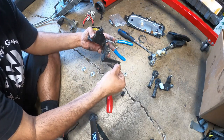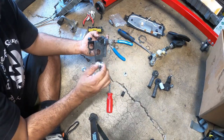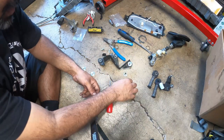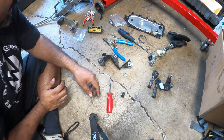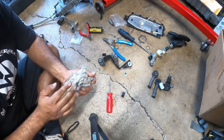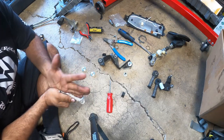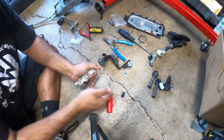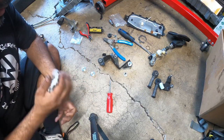Gives you pretty much a solid bracket versus a rubberized bracket, so no vibration. A more direct, more sporty feel to your transmission. This is a super cheap upgrade. They're typically about $30, $40 at your door with taxes and shipping. So an easy upgrade for anybody's Mark 4, Mark 5 shift linkage. Again, this just gets rid of the slop of a rubber bushing and gives you a billet part. So that one's super easy to do.